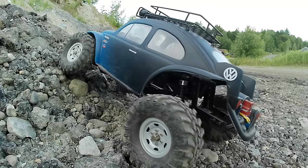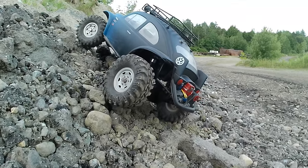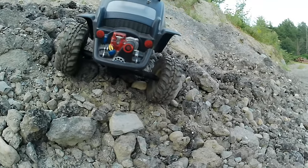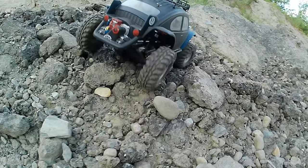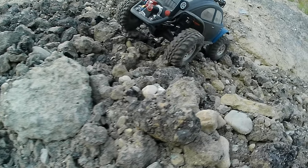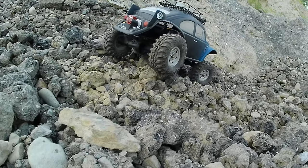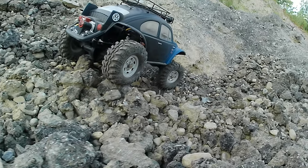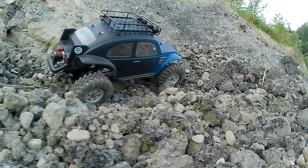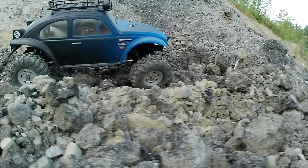You'll see some of that articulation in the footage, but at this point I've been running for a few minutes so the shocks have pretty much seized back up again. It's so annoying, because you basically think just looking at them that they would work. I've tried different oils and running low CG without the coils so they run fully compressed, and nothing seems to work. I'm just going to order a set of four replacement shocks — we'll see what I do.